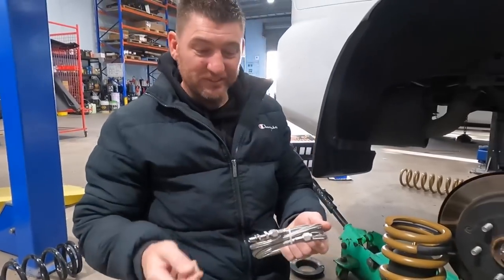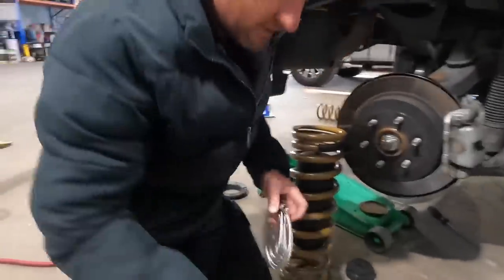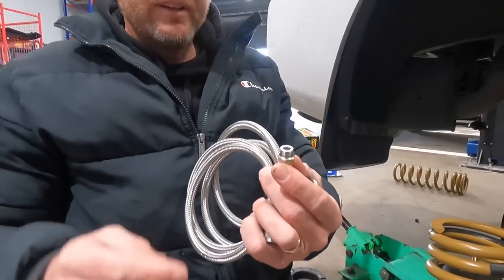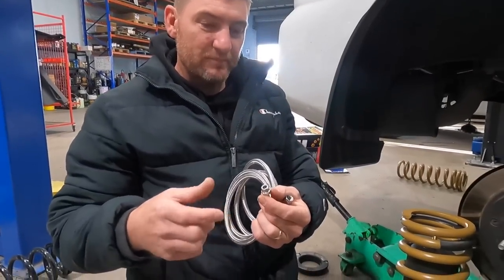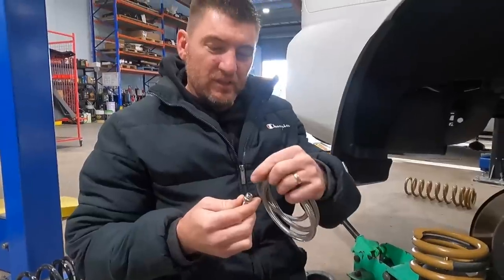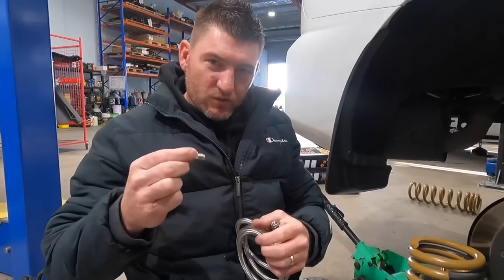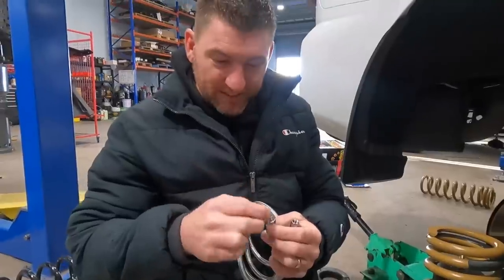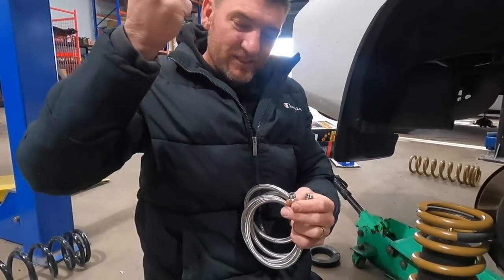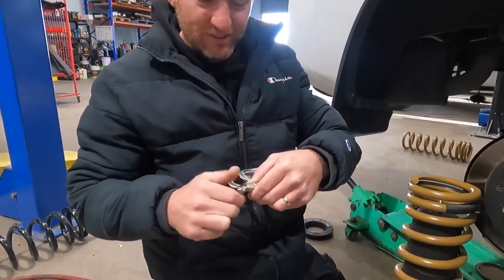If you've got on-board air, they've even thought of that. There's an adapter here - on-board air still comes with the black pipe and we understand you've got to work with that. But the fitting is excellent. I've played around with all the on-board air stuff, all the little adapters, T-pieces - whatever they give you - and you have a bit of trouble getting the internals to seat properly. The old ones have a little steel insert that locks onto the hose when it goes in, and sometimes that steel insert goes over the O-ring inside and causes an issue. These ones are solid - the quick release is all one piece, so when it goes in nothing can drag over the O-ring. It slips in nice, goes over the O-ring, locks done.